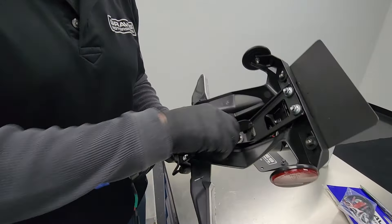Same thing on the other side. Now these little pieces prevent this from flexing and letting the turn signal pop out. The other piece locks this in place. Pop that one out, pop that one out. Now there's still a little plastic piece that's down inside these and I just use a little pick to slide them out — this gives it rigidity and stops it from falling out as well.